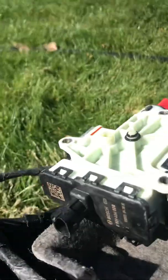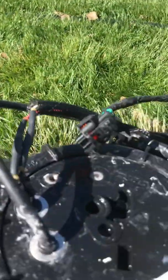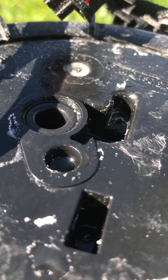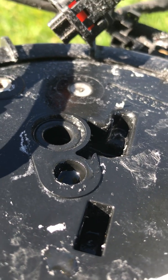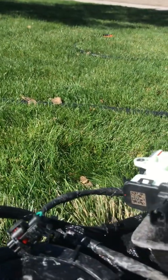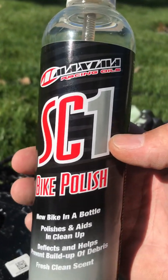So I'm in the swimming pool industry, and I know that you're not supposed to use any petroleum lubricants like Vaseline or anything on rubber O-rings or grommets, because that will deteriorate that rubber. In the swimming pool industry, we use silicone-based lubricants called Magic Lube, and the Magic Lube Blue is suitable for that. I don't happen to have any.